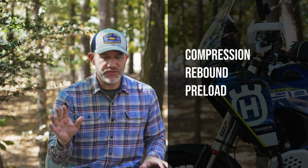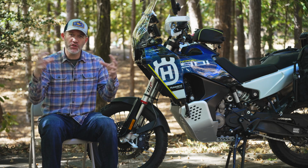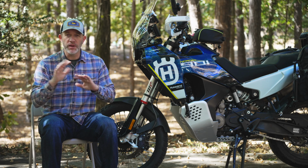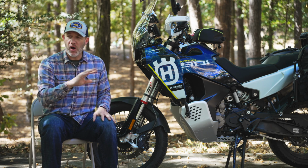Before I dive into that, I want to loosely define 3 terms: compression, rebound, and preload. And if you've seen Ari Henning's video on suspension, you're probably already deeper in this than I ever will be, but really quickly, compression is just like it sounds. It's when the spring compresses or gets shorter. And rebound is the opposite of that. It's when the spring gets longer. And preload adds compression to the spring while it's at rest. Now, those are loosely defined terms, and of course you could pick those things apart in all their various glory, but we're not going to get into all of that here.